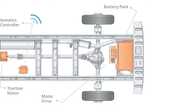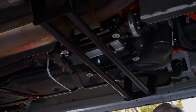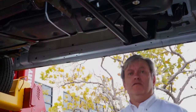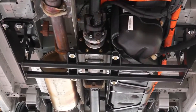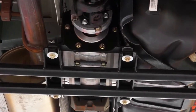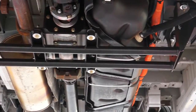We remove the stock driveshaft. We install a traction motor with a supporting crossmember here, and then a custom front driveshaft and custom rear driveshaft that connects the OEM gas powertrain through the traction motor to the rear axle to drive and propel the vehicle. In parallel, we can add or subtract torque from the electric traction motor to save fuel or regenerate the battery pack on deceleration.